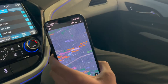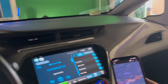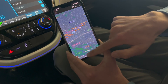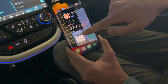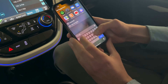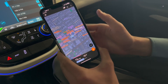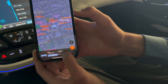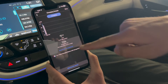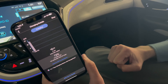We've started a charge from the app — you can see on the charger it says charging. It's supposed to show status in the app, but we encountered a bug where it didn't. I'm showing this because it can happen to you. The most common troubleshooting fix with any of these apps, regardless of the charging network, is to force quit the app. On iPhone, go to your app menu and swipe up on it; on Android the process may differ. Reopen ChargePoint — now the state of charge is reflected in the app: the battery percentage, information from the charger screen, and a helpful graph of kilowatts going into the car over time.